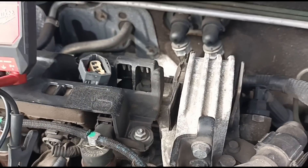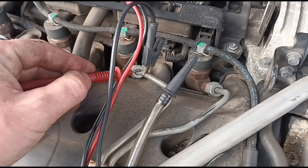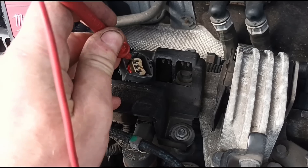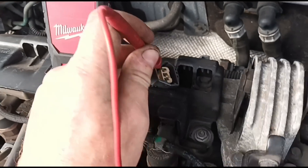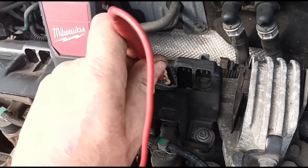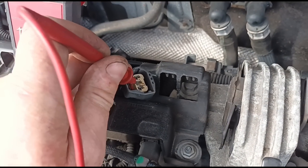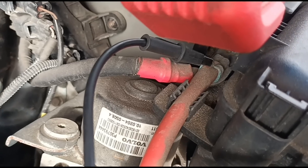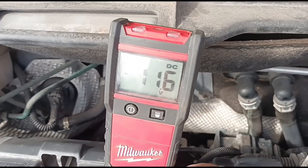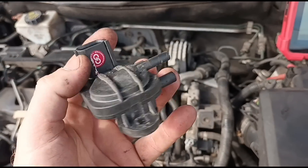Unplug the sensor and hook up a multimeter. Add the earth onto the metal of the engine there and we should get two 5-volt signals — 4.9 volts, and then this side over here 4.9 volts. Then the centre one is going to be the earth. If I connect the negative over here to the live of the car and put this into the centre, you should see minus 11 volts — so that means the earth's working. That brings it back to this sensor being a dodgy sensor.